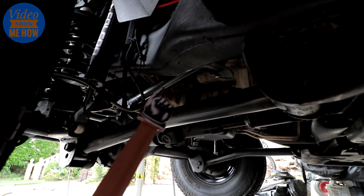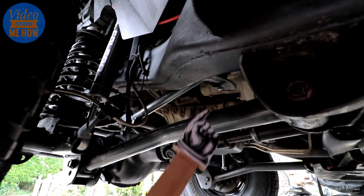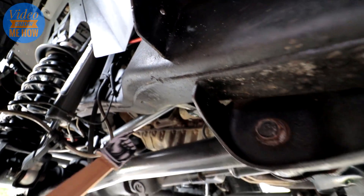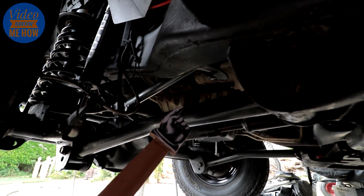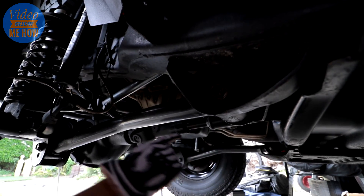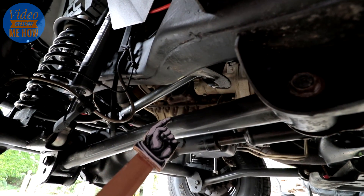There you go — your lower control arm and your upper control arm. The reason you'd want to upgrade these is to sort out your caster, and that's the proper way to do it. Things like AEV in particular do a good set of geometry correction brackets — it fixes your geometry by effectively lengthening your lower one and shortening your upper control arm, getting you closer back to a standard factory caster. So your two options if your Jeep's feeling really flighty: get a wheel alignment done first, then either get geometry correction brackets which do the job but reduce a little clearance, or if you've got the budget go get a full set of adjustable control arms to fully dial in your caster.